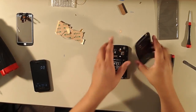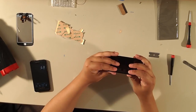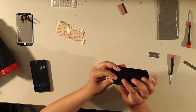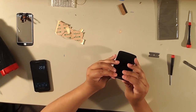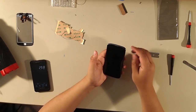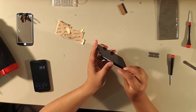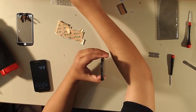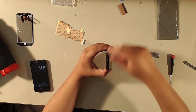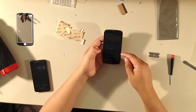By packaging, I mean the screen protector that it comes with. After the screws are all in the frame, put the backing on — go along the edges and clip it all in. There are about five or six clips and make sure they're all clipped in properly with no gaps between the frame and the back. Now remove the screen protector — don't remove it before this step. Everything looks good, power it on, put the SIM card tray back in, and put the two bottom screws in. We're good to go.